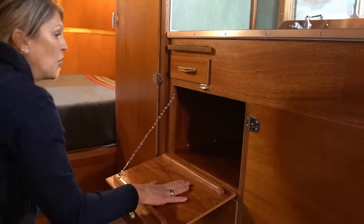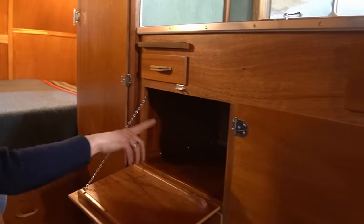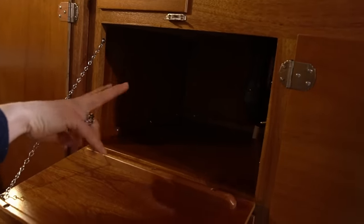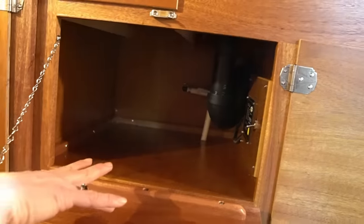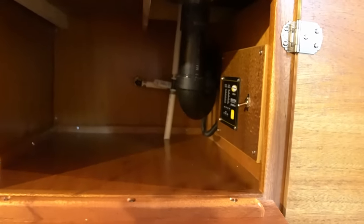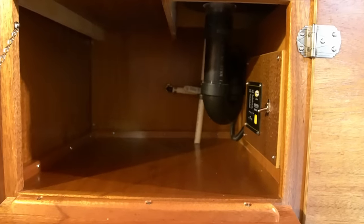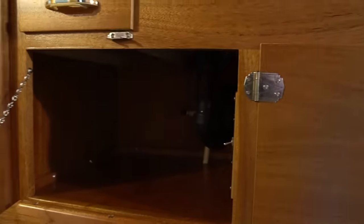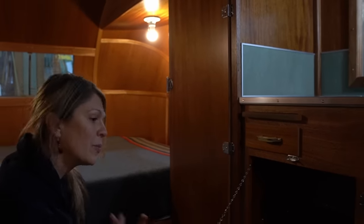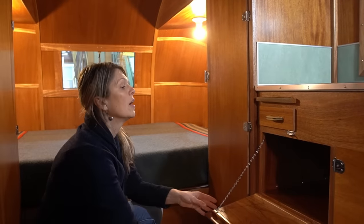If you look under here, you'll see one feature of this trailer — this is where we hide the systems. The remote for the Go Power system is here. We have a 2000-watt inverter system and two six-volt AGM batteries, and this whole system is solar ready. So even though we've stayed true to the vintage original look and feel, we have hidden some really cool and necessary updates that bring us into the modern world and make this something that will really function for the owner.